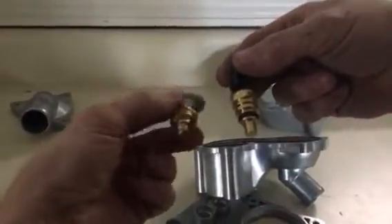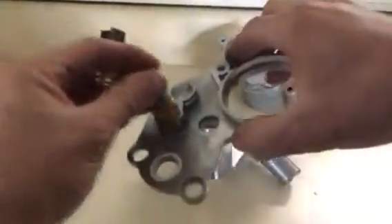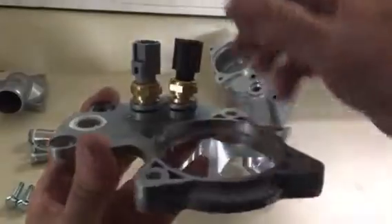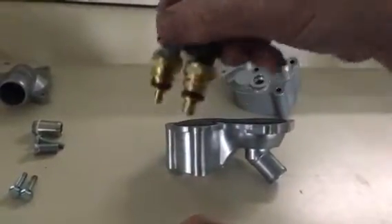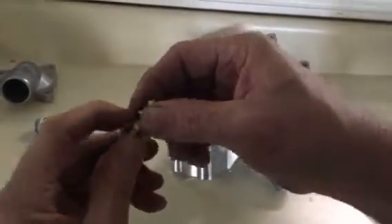Here are the sensors that come in this kit — they're Chinese knockoffs, you can tell. First thing is these O-rings are made out of silicone; they're not made out of the right material from the factory, and they're also the wrong size.